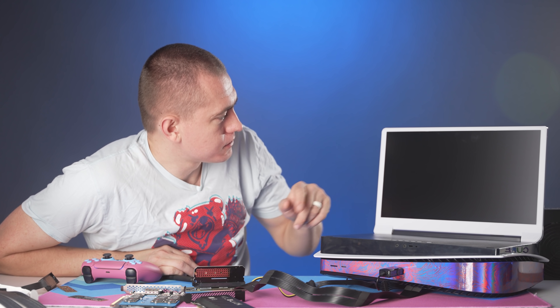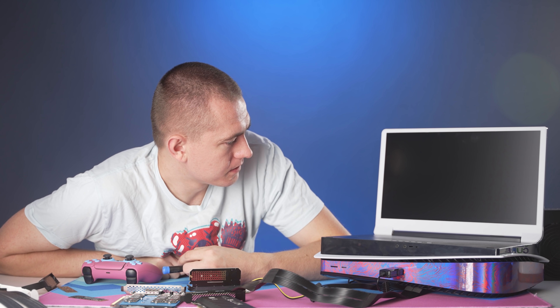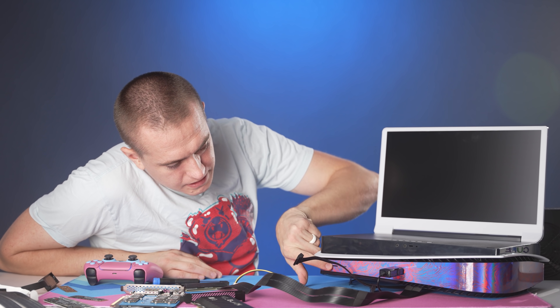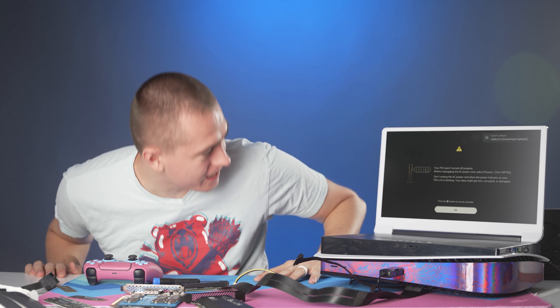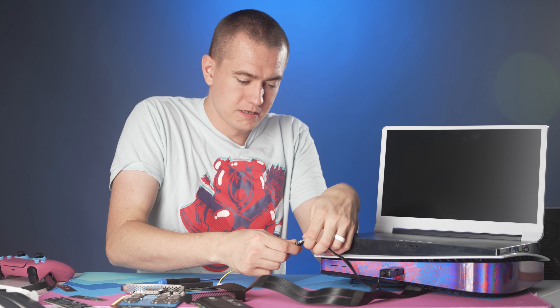The SSD is running hot and keeps rebooting. I'm going to unplug the PlayStation and this entire situation. I wasn't expecting that. I might have to unscrew the M.2, but last time that didn't quite matter. I don't have a bricked PlayStation — oh man, I was worried. I might have a bricked SSD though — that's a possibility. We're going to try it again, but this time I'm actually going to supply power, because without the PC power supply on, it was probably drawing too much power from the M.2 slot and just shut itself down.